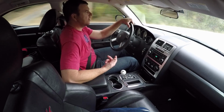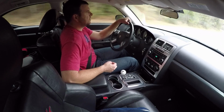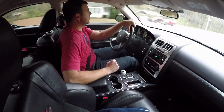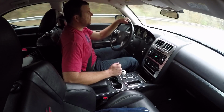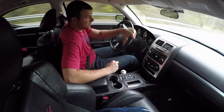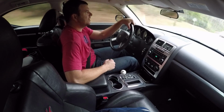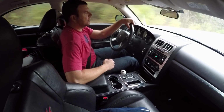Ended up getting a great deal. They threw in the 6.1 exhaust manifold gaskets. I've always heard the JBA Shorty header gaskets are just garbage. Don't even waste your time with them. I also purchased the 6.1 exhaust manifold bolts to use, because they come stock with a thread lock kind of deal on the thread, so you don't have to worry about them backing out or anything like that.